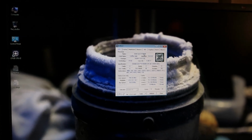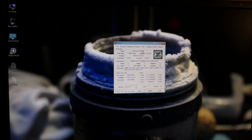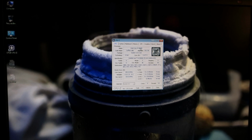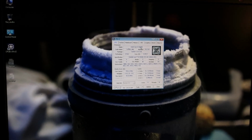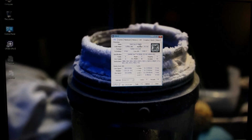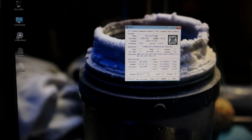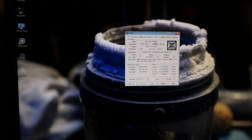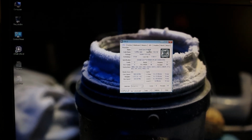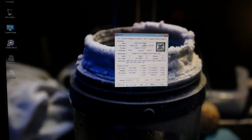So that's why, when I install any OS, like for overclocking or benchmarking purposes, I install all of them from a DVD, apart from Windows 10. So XP, Server 2003, Windows 7, Windows 8, 8.1, Server 2012, all of them I mainly install from a DVD. Windows 10 I install from a USB stick because you can get a faster boot when you use UEFI, and Windows 10 is very easy from a USB stick. But at least if we talk about Windows 7 or older, DVD is a lot easier. So yeah, that's pretty much it.